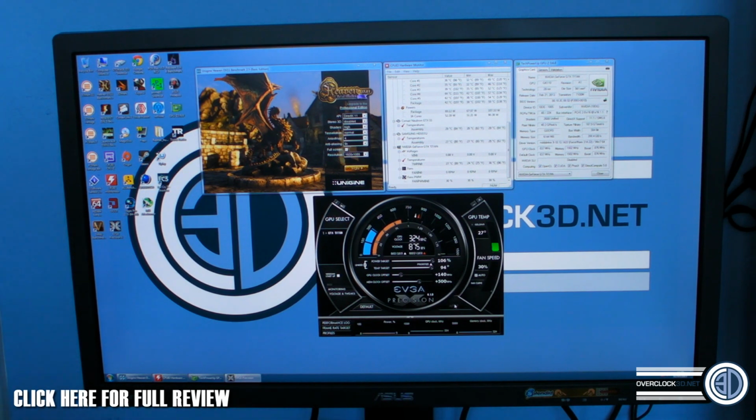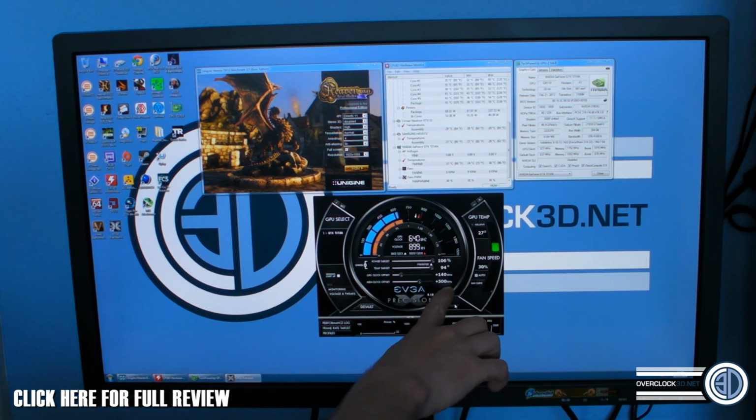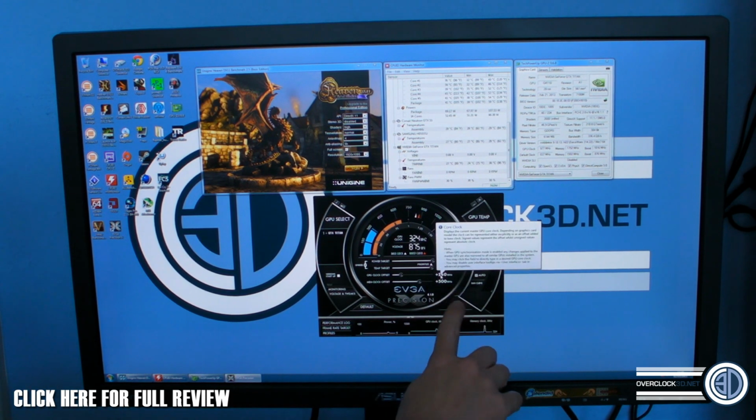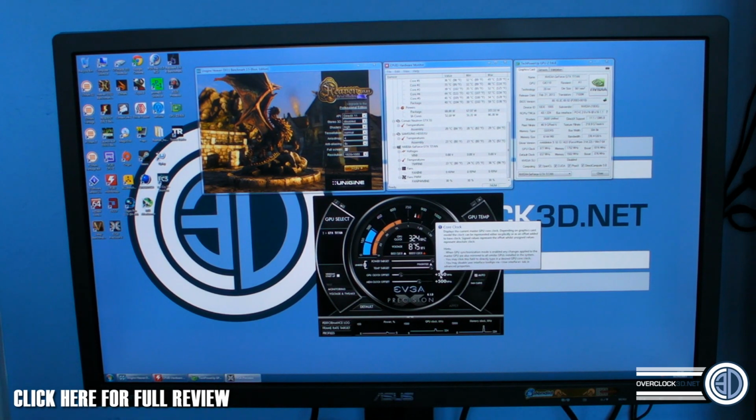So that's just to explain why this has gone down but this is so much higher, and that literally is our best. The reason why we favoured slightly higher memory over that extra 10 megahertz is that when you're running 2560 by 1440 results, the extra memory speed helps with the extra pixels and all that extra high resolution. By dropping this one and increasing this one, all of our benchmarks did go up. Maybe not by a lot in some, but anyway.